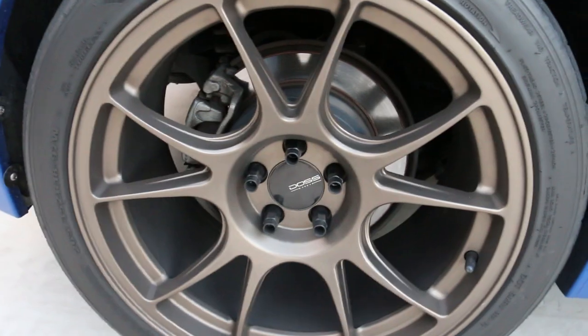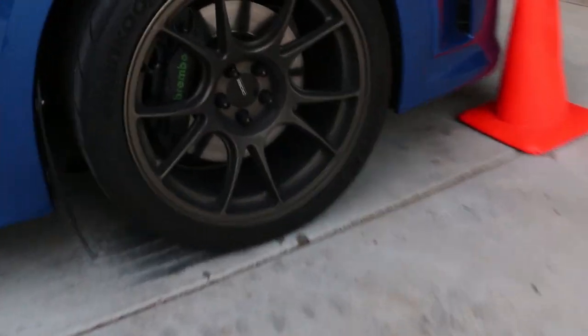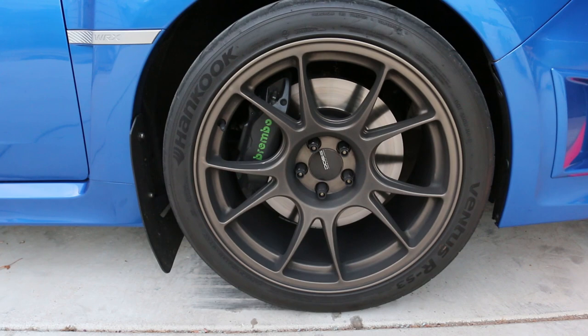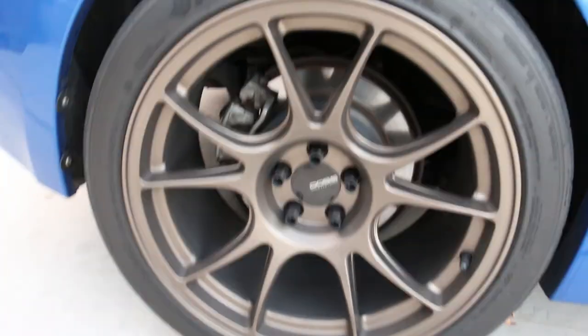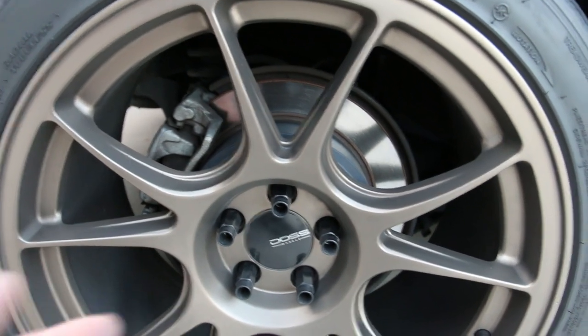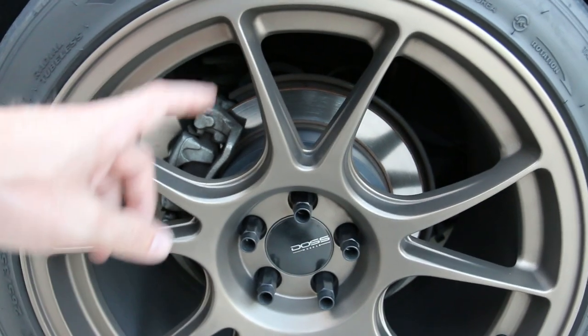Now I know you guys want to know what I've done to the back brakes. The back brakes on this car are still stock — stock calipers, stock rotors, and stock pads. Now I do have race pads in the front. You might say that's stupid, but I didn't want to buy two sets of pads. Will that throw off the brake bias? Yeah, probably quite a bit just because of the pads in general. But I didn't want to spend money on the backs because I'm probably going to upgrade to something like an 06 WRX rear two-pot caliper. You guys see those on rally conversions — they fit underneath either a 15 or 16 inch wheel. They're a really good caliper compared to the stock one.